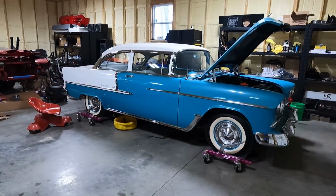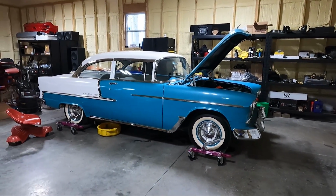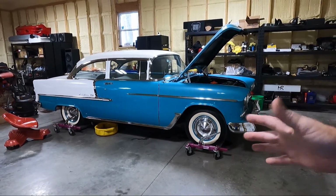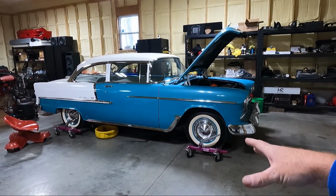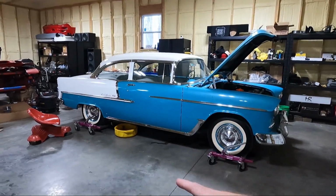You guys saw that in a video recently too, where we took the heads off of it. We're going to be using it on the Trans Am. I'm thinking some LS3 heads, an LS9 cam, just a stock LS3 intake for now. That's the goal with the 4L80 transmission. Get it running and driving with that.